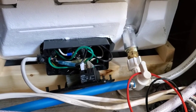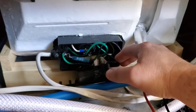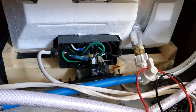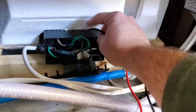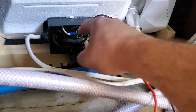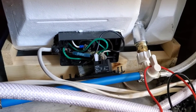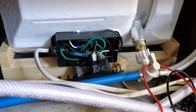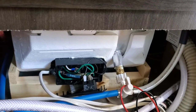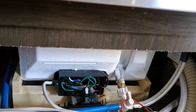Okay folks, here's the test. I flipped the switch on, my relay has closed, and I am getting continuity between the two sides of the contact — the normally open contact. That means my power coming in is now flowing through the switch, through the hot wire, onto one side of the element which will heat the water heater. So there it is — we've gone through our troubleshooting, figured out what it was: the relay burned up, which caused the board to short, and both needed to be replaced.